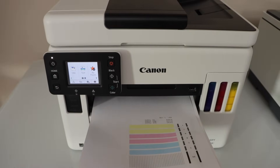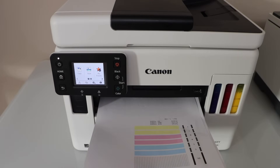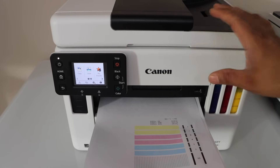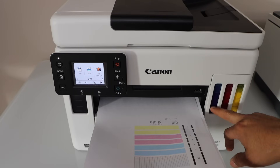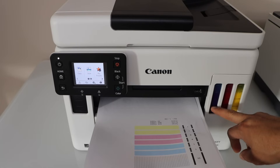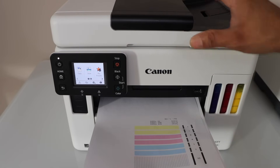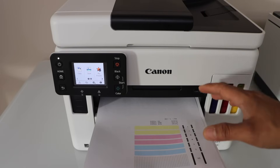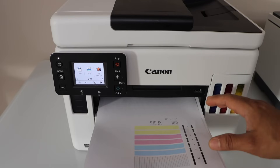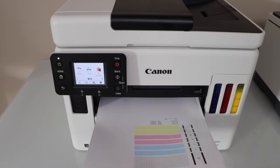Click on the home button. This way we can fix the clogged ink. If there is no ink in the pipes and your printer is printing blank pages, following these steps will help you fix it. Just make sure if you don't have ink in the ink pipes, do the ink flush with enough ink — at least one level from the bottom. If you have ink in the pipes but it's still printing blank or missing some colors, just do the cleaning and deep cleaning to fix the problem and resume normal printing.